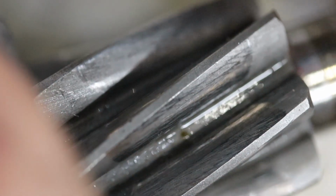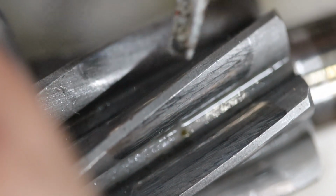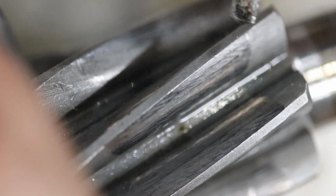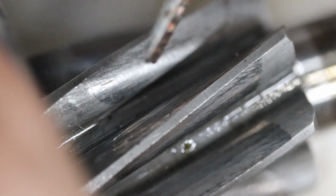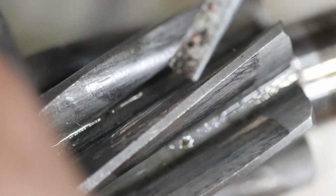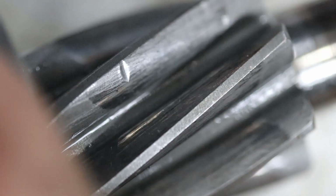What we're looking for is if that area looks particularly lower than the rest of the gear. So we can see a wear mark there, which would have happened as soon as the car drove off the factory lot pretty much, but there's no big low spot. If there was a big worn-in dip here like that, that would be a problem, but this one looks okay. You can take up a certain amount of wear with that adjuster in the bottom of the rack, but this one looks okay. The only damage I noticed on this, if I turn it around, is this mark in it here.